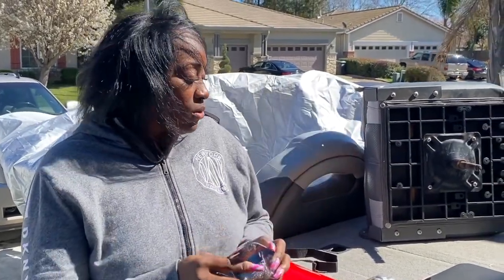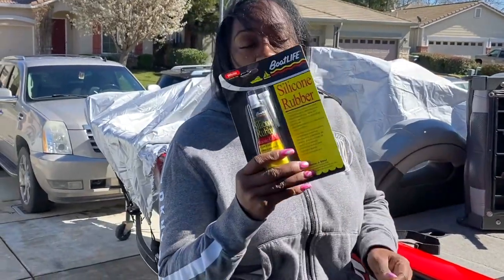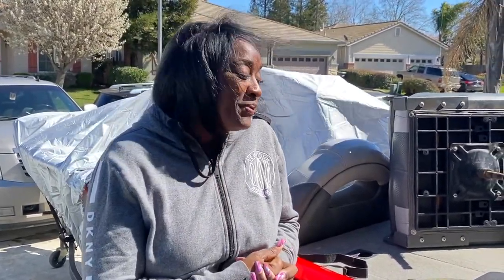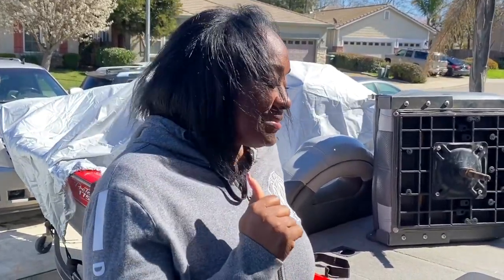So we got it in. We cut off just enough where we still have a little space to cut a little bit more so we can fit this in. What I'm working with today is the aerator strainer and some silicone rubber. You want to make sure you use marine grade. Other than that, so far it's looking like this is a good deal with this boat and we'll get it going. Alright, let's finish this up because it's cold.